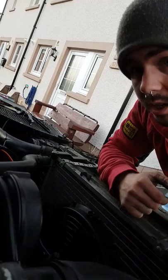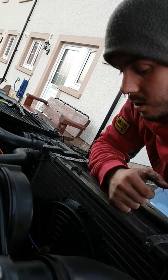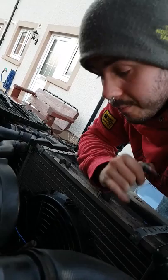As you can see, I have no viscous fan. Who wants a viscous fan? They're heavy, they're expensive to replace, they're heavy on the mileage, and they pose a massive threat to your radiator. If, like mine, you have really shitty radiator bottom brackets and your radiator falls off, it'll destroy your radiator. So I got rid of mine.